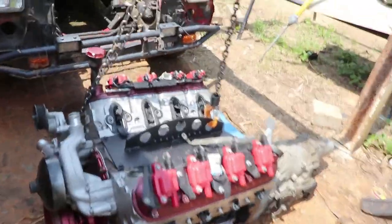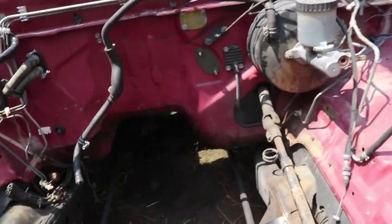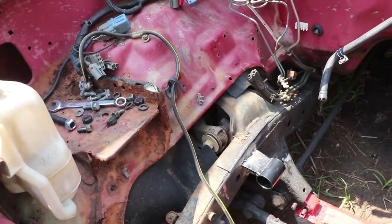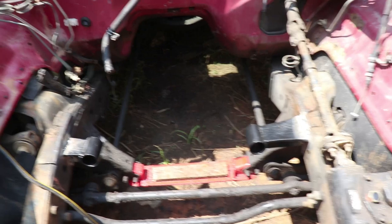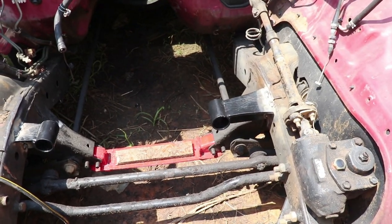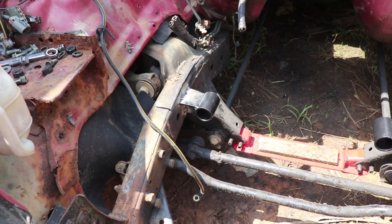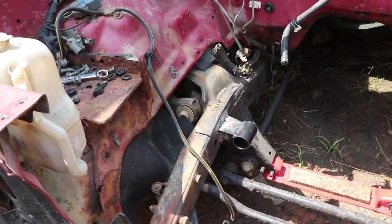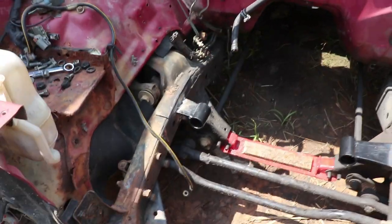Motor's out again. Here are our mounts — we've got to clean up all the soot off those tacks, get it down to bare metal. I took the bushings out of the mounts; they were tight but I was able to get them out. Then we're going to do a solid weld on these — clean them up real good and do a solid weld.